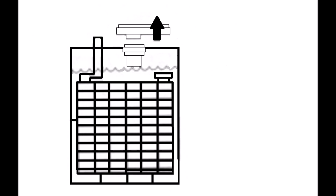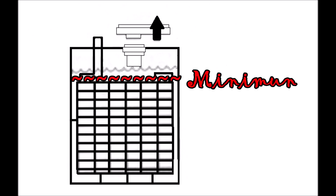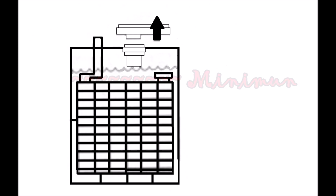On a side note, if the battery is weak or dead, only fill it up to the minimum. Because when a dead battery is charged, the electrolyte will rise, and you will need that space for the level to rise when the battery is charging.